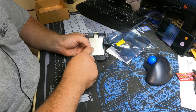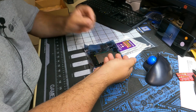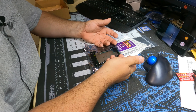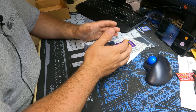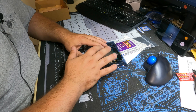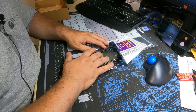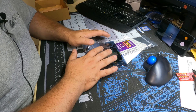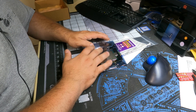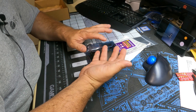Look how big this thing is — Intel Xeon Phi 7290F. What I currently have in my system is a 7210, which has 64 cores and 256 threads, a base speed of 1.3 GHz, single-core boost of 1.5 GHz, and all-core turbo of basically 1.4 GHz. The 7290F kicks it up from 64 to 72 cores, and from 256 to 288 threads. The base speed is 1.5 GHz, single core is 1.7 GHz, and all cores run at basically 1.6 GHz — that's 200 MHz extra on all cores.